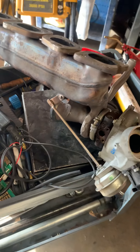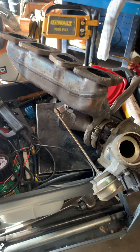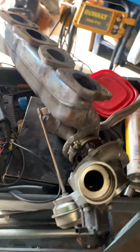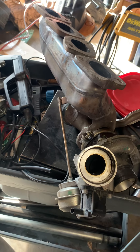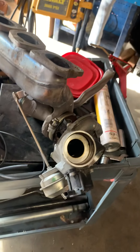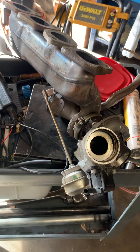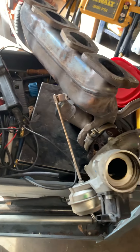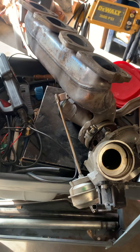This is a really quick video just to illustrate some of the questions I had before actually figuring this out. I have here a 2016 Mercedes C300 and the customer came in for a complaint with code P0299 — pretty much under boost, losing boost pressure. I did a smoke test on the vehicle and didn't find anything wrong with any hoses or any leaks whatsoever.